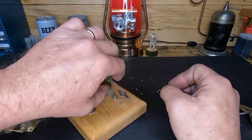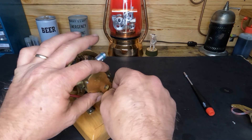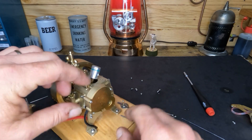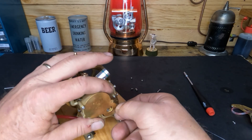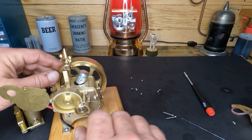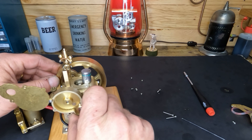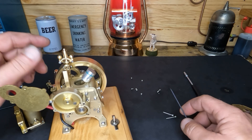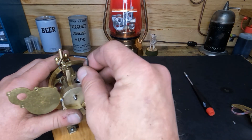We'll get this screw out — it's not gonna come off because it's solid on the backside. We'll flip it up out of the way; it's nutted and that's what's holding our hall effect sensor on back here. We can see our magnet in there, so we're gonna have to take our cam gear and crank gear off. We already know we'll have to redo the timing on this because the whole thing's coming apart.